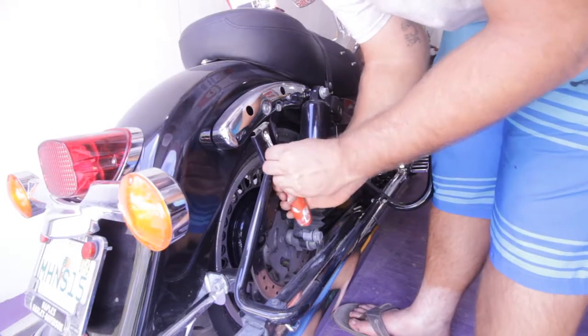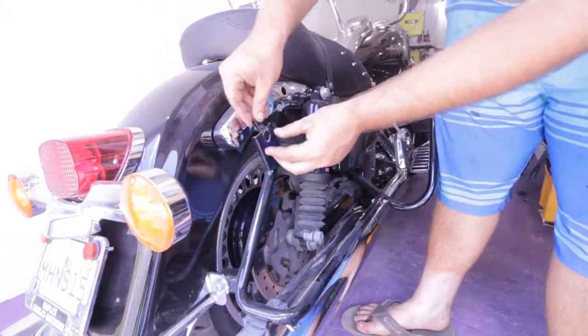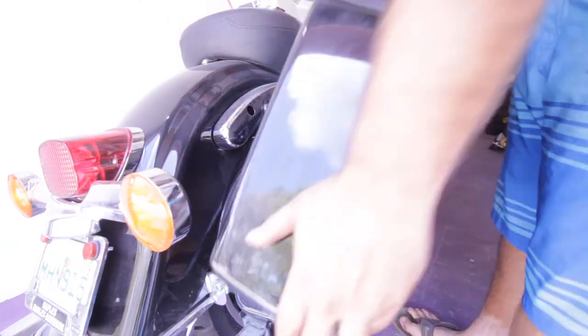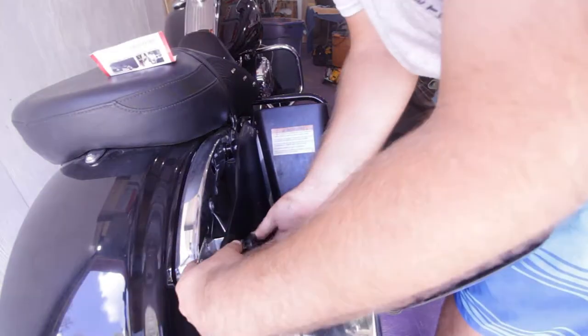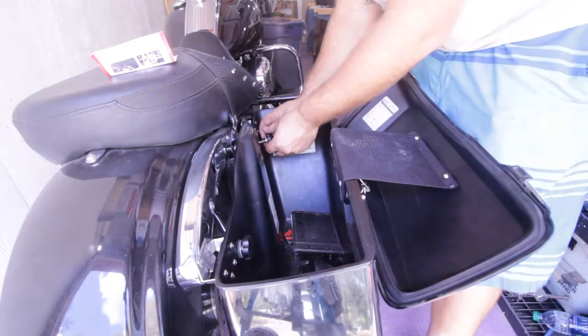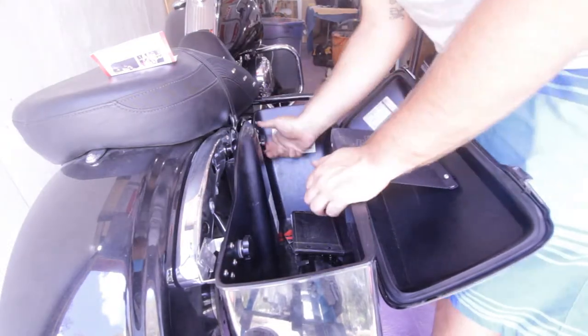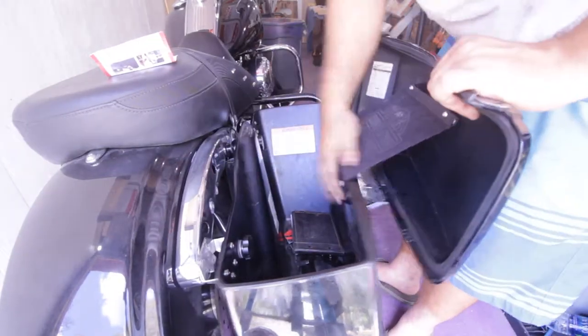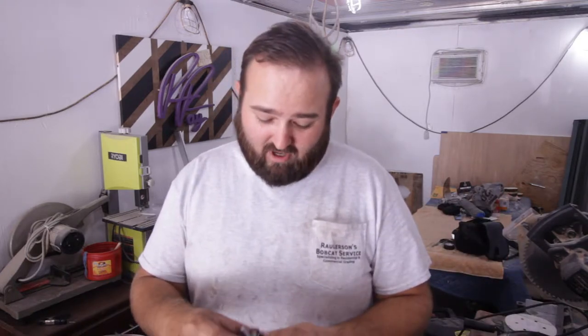It's a pretty simple install. Take the old pins off, take the bags off, take a flathead screwdriver, pop the spring system out of place, and the new clip fits right into it. It took about 10 minutes altogether, and that was with me moving the camera around to get a few shots for you guys. All in all, definitely something to look into if you didn't know about it. This system — EasyLock — I will link in the description below. I did find some other systems that were quite a bit more expensive or wouldn't have arrived as fast. I like to use Amazon Prime — two day shipping and I'm back on the road.